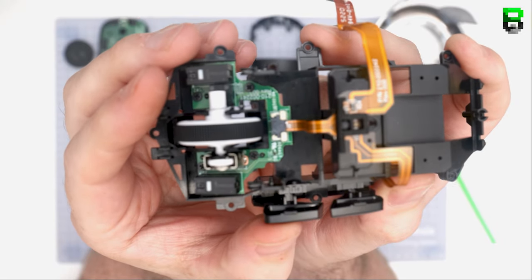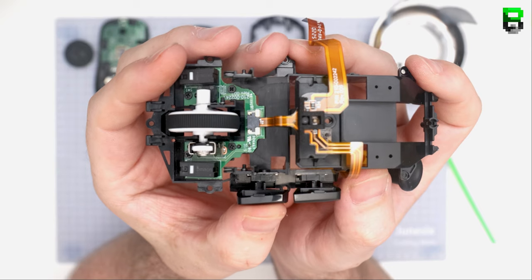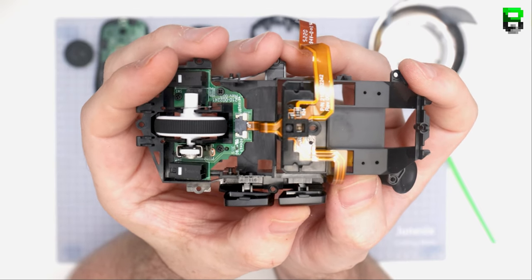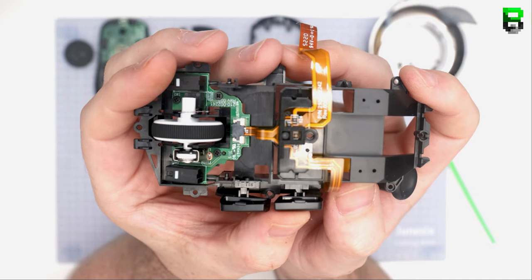You'll see that the GPro wireless Superlight here has some pre-travel on the side buttons. This is what creates the mushy feel. It also does it on the GPro itself. It's a little bit unique to the GPro, so you won't find this on other mice. And there's a few techniques to get around this.